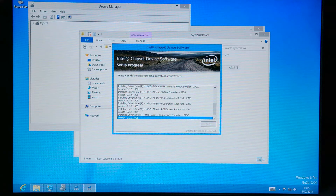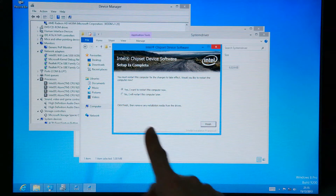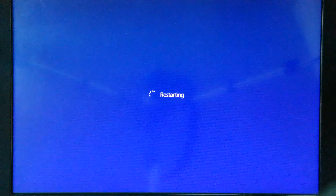For the AMD Radeon graphic card drivers, please use the one which we include on the driver CD, which is also on our webpage. That's an OEM specialized driver which just runs — it's optimized for the integrated 7410M graphic chipset, for example to support special power energy saving options which are not included in the standard AMD driver. So after we install the Intel chipset drivers, you should follow that installation and take this from our webpage or from the driver DVD. It's next. We want to restart. So let's restart and then we go ahead with the graphic chipset driver installation.